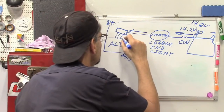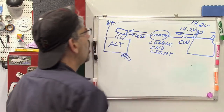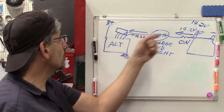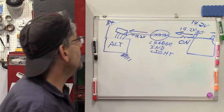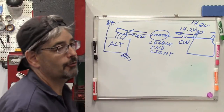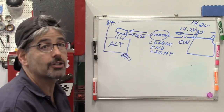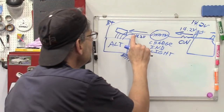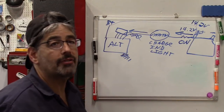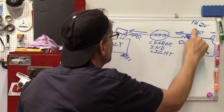However, because the alternator is running, the function of this wire is to also feed back alternator voltage. So now we've got a pushing match going on — an arm wrestling match over this indicator light. If we have 14.2 volts coming from the alternator, but also we've got 14.2 volts from the battery, well now we have no voltage drop. So the light is not going to light. But anything less than that — let's say the alternator is not working — well, now we've got the same situation as before. You're going to have somewhere around 12.6 volts.